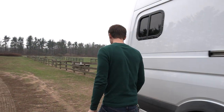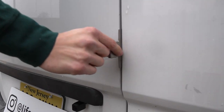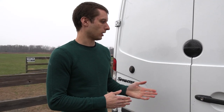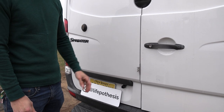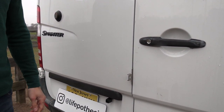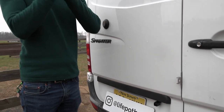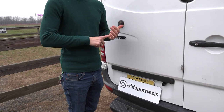Now Austin is going to take us around back and show us the garage. In the rear of the van, you can see the connecting points for the SlickLock. According to what we found, the weak point for someone trying to break into the Sprinter van is actually these rear doors — you can get a crowbar in here and pop the bottom latch fairly easily. So this lock reinforces it, and the nice thing is you don't have to bolt into the metal — it actually uses existing mounting points. This is also our rear-view camera, which connects to a display that's also a forward-facing dash camera in the cab. It's actually a security camera as well — it detects motion and records, saving a video in the event of motion or an impact.